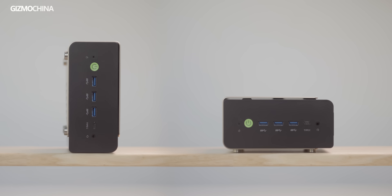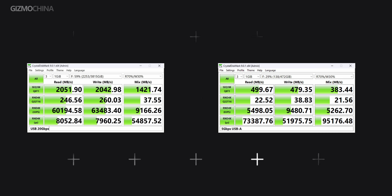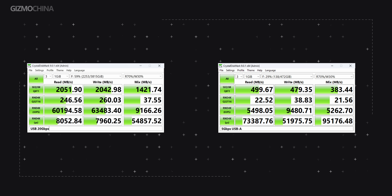It's slightly larger than typical mini PCs, supporting both horizontal and vertical placements. It can also be mounted on the back of a monitor using the included VESA mount, which saves some desk space. The T1 features three USB ports with 5Gbps speeds at the front. The far-right USB-C port supports 20Gbps speeds and also DP output, with all ports capable of reaching their maximum speeds.